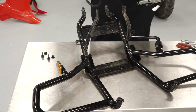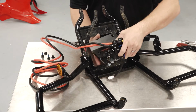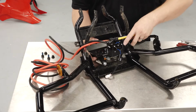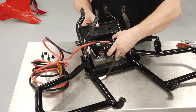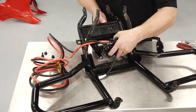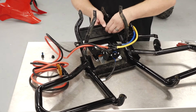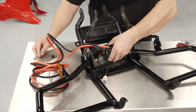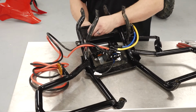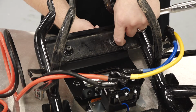We'll put the roller plate assembly into the bumper, and that slides into position on the front part of the bumper, and then using the 2 screws and lock nuts, we'll loosely secure it together. Next, we'll tighten and torque to specification.